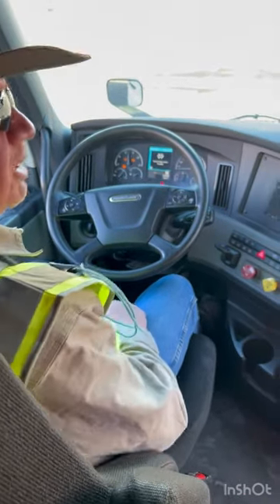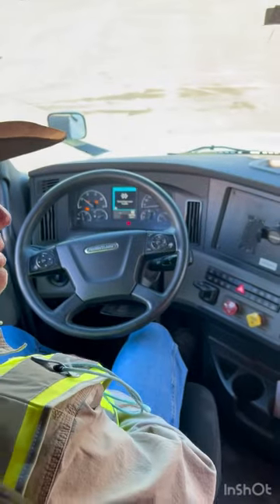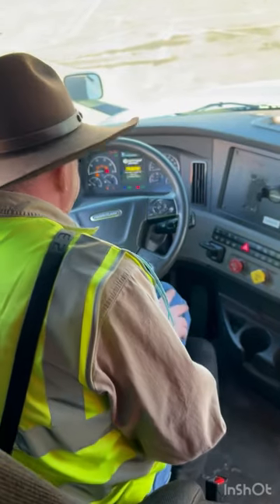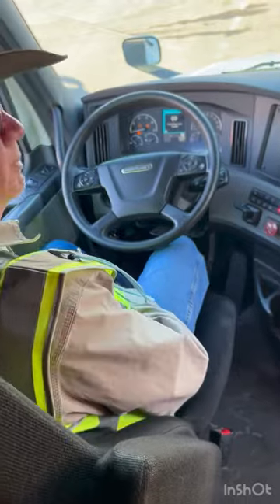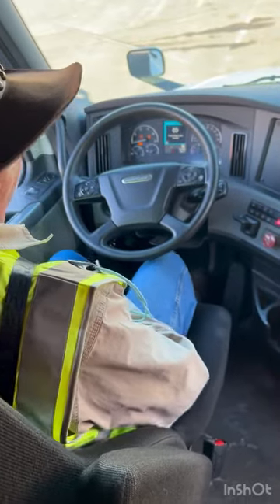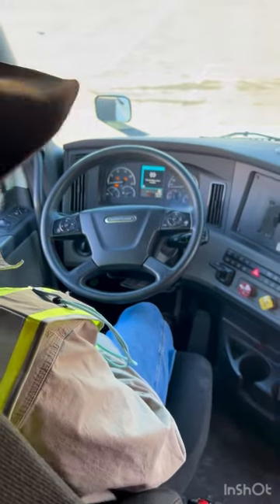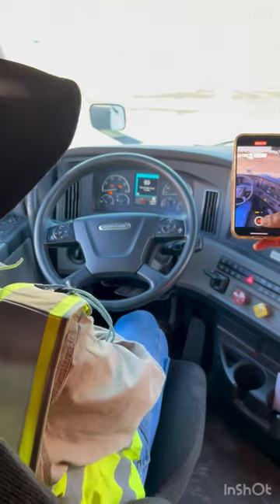My governor has shut off — we heard the sneeze. I'm at about 125 PSI. I'm going to turn my engine off, key back on. We're going to release both brake valves. I'm going to push my pedal to the floor and hold it. I should not lose more than 4 PSI in 60 seconds after my initial air loss. My gauge has stopped moving.